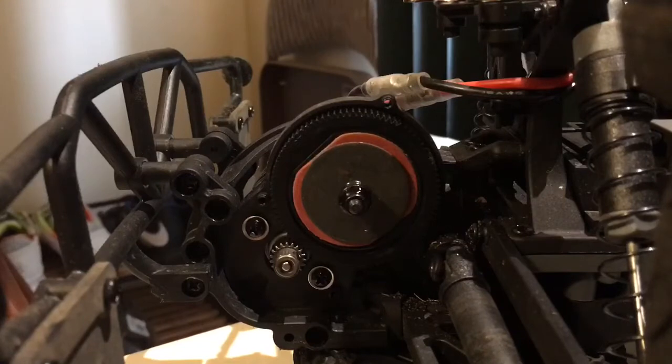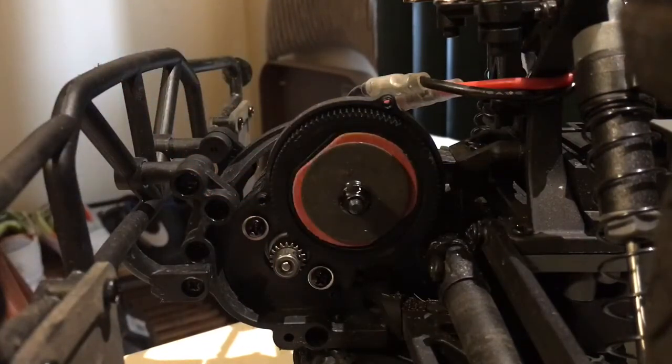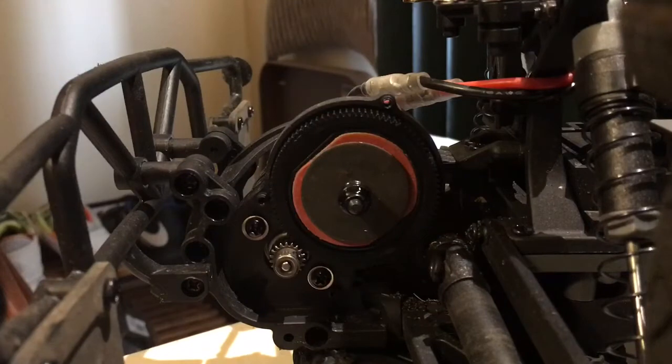In pretty much every RC vehicle, your motor is held onto the motor plate by these 2 screws. In front of the 2 screws, you have the pinion gear, which you're going to most likely need to take off before replacing the motor. So in order to detach the motor from the motor plate, just use a Phillips head screwdriver to get these 2 screws out, and maybe even pull the pinion gear off, depending on how large the opening in the motor plate is, and your motor will just slide right out backwards.